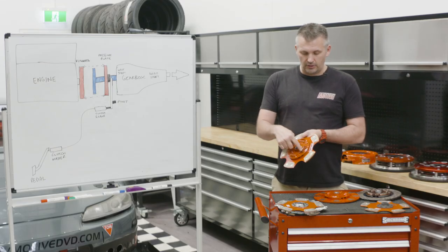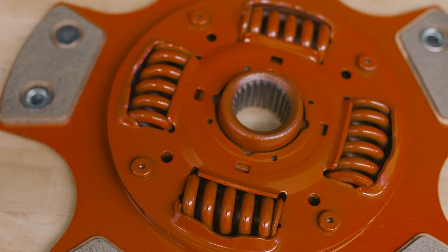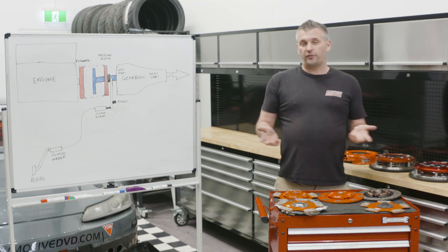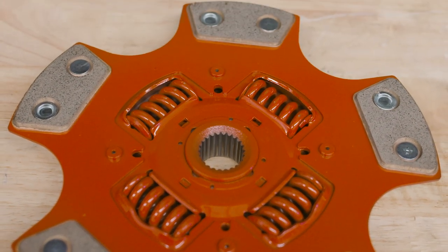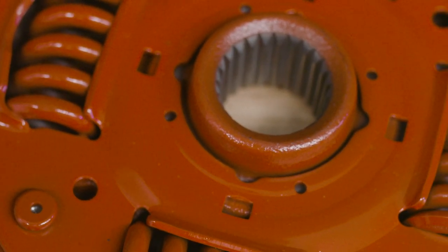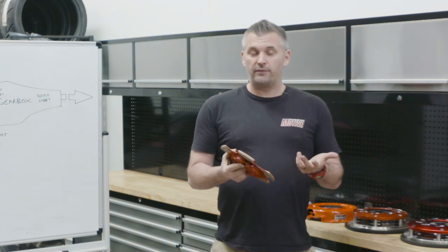This is a sprung clutch plate — you can have a look at the centre, there are springs in there, hence why it's called a sprung clutch plate. What does it do? The input shaft goes into here on that spline, and as it starts to grab onto the friction material, these springs just take up some of the shock loading and dampen or smooth out the engagement of the clutch. Manufacturers do this for obvious reasons — it helps dampen the shock loading onto the drivetrain, looks after the drivetrain, and just helps make for a smoother car to drive. However, it adds a lot of complexity to the clutch and it adds weight. If you want to get the weight down, you've got to get rid of the springs. If you want to fit multi-plate clutches into your clutch assembly, you can't fit as many clutch plates with this giant spring assembly.